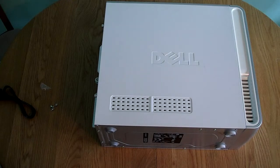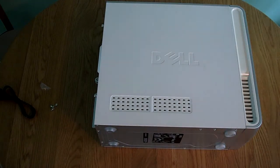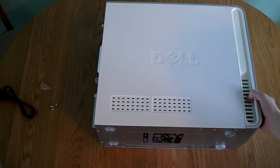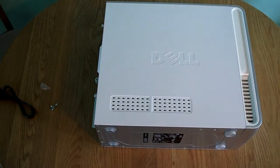The first thing you want to do is unplug everything from your computer and set it down on a nice wooden surface if you can. Once you have unplugged your computer, leave it a while so there is no electricity stored in the components inside. You might want to press the power button a few times to discharge all remaining power inside.